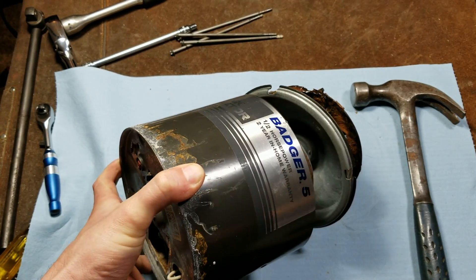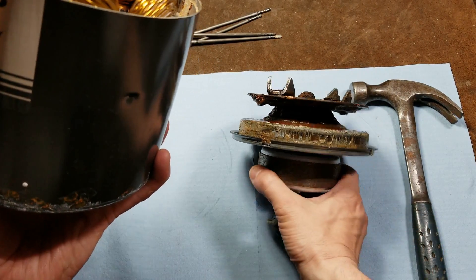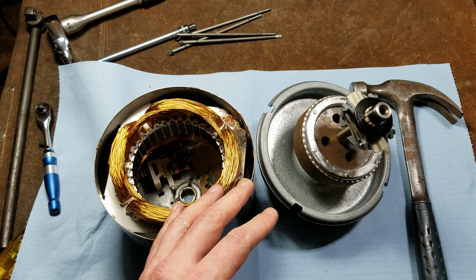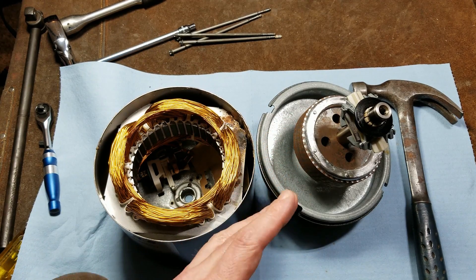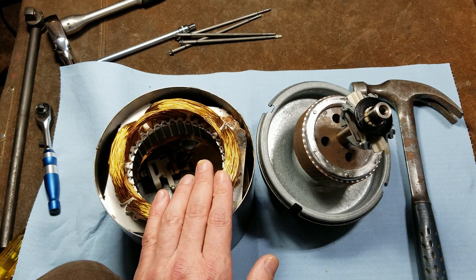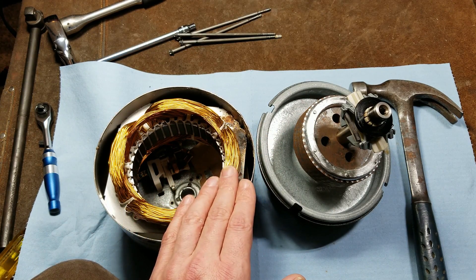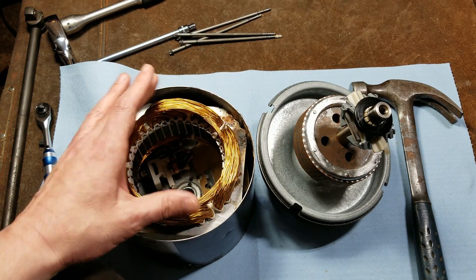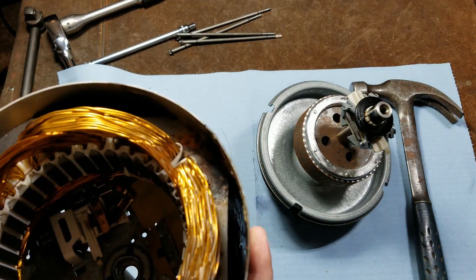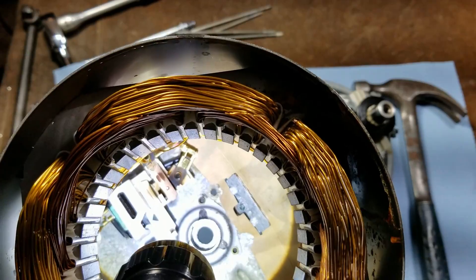Fortunately I let this air out and there we go — now that's actually quite interesting. Let me flip this upside down. So they have an induction motor, which is fascinating — I always thought these were brush motors but they're not. They're half-horsepower induction motors. This is an interesting one: instead of having a capacitor, which could introduce a little bit less longevity, they use a clutch system. This has what's known as a startup winding and then a switchover once it gets up to speed to its power windings. We can see that here — we have these thin startup windings and there's a switch down there. We can see how burned up that is. So that's probably one of the things that kills these: that switch ends up arcing to the point that it just doesn't work anymore.